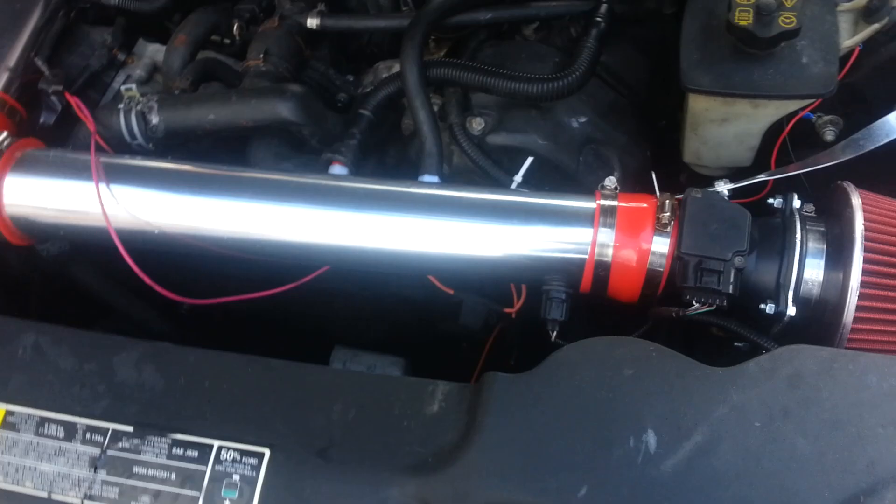This is to show people that you don't have to run the battery all the way to your trunk — just run it to your fuse box. The power does get sent up here to the fuse box from the battery. Just find one; you've got a couple unused ones right there — those silver parts that feed power to your fuses.